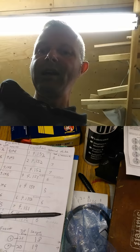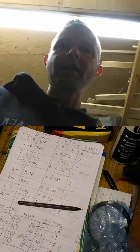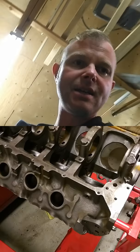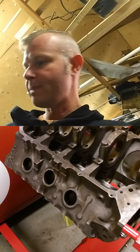I've double-checked all the measurements from the machine shop — the bores are spot on and the pistons are all the right size. My ring gap measuring is accurate. I now need to file open all these ring gaps. The oil control rings are fine — they need to be a minimum of 16 thou and they're all within tolerance. I hope to be filing these down, putting the rings on the pistons, putting the pistons in, and then we can start putting the crank in and moving on. It's been a long journey — I had to see my friend Paul to get a hand — but it's getting there.